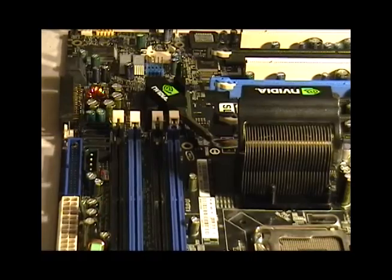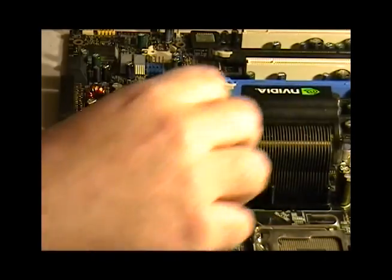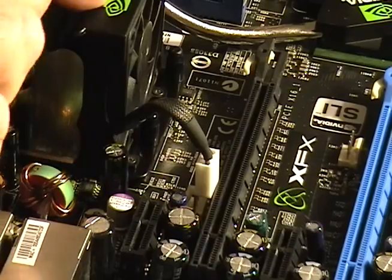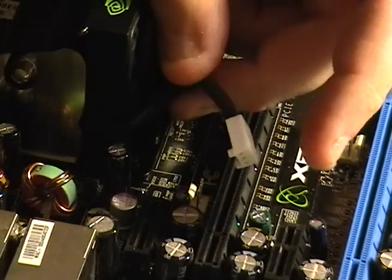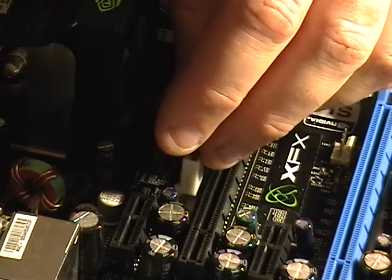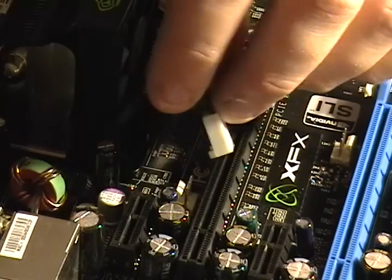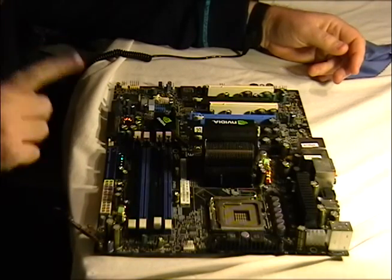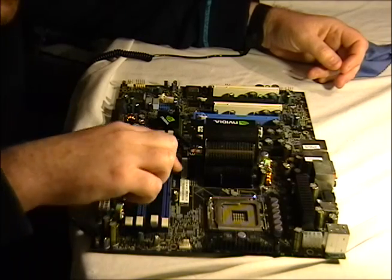At this point I've put all the spring snaps in — I just call them spring snaps. This is a pretty solid connection, and you can actually use this to maneuver the board around as long as all the snap springs are in. The last step after mounting is to install the fan power to the CPU fan connector — there'll be one nearby, so just use the closest one. It's a three-prong connector, it goes one way and just pops on. And remember, there are little transistors and capacitors even on the back of the board, so be careful of those — they get hit a lot.